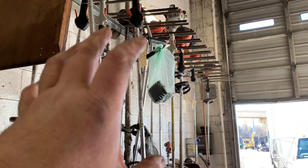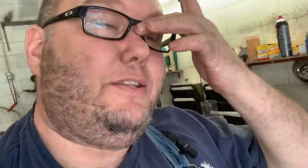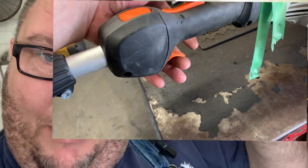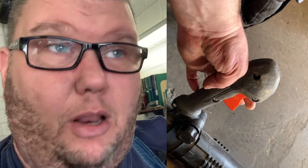I've got a couple of Echos and a few Stihls here on this rack — the ones that aren't finished yet, waiting on parts. When they're done we swap them over to this other rack. Now it gets confusing because some of the Stihls have the auto choke: you just twist the choke, it sets the throttle to about half throttle, you crank it, and when you hit the trigger it knocks it off choke to the run position. Some of the Echos don't have that, so you have to manually grip the handle and pull the throttle wide open. These guys are trying to start trimmers and blowers with no throttle — they just sit there and pull and pull.